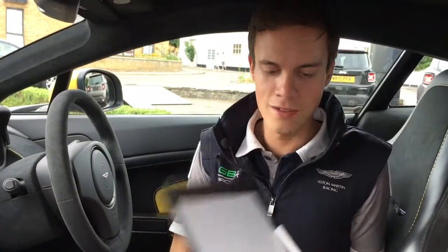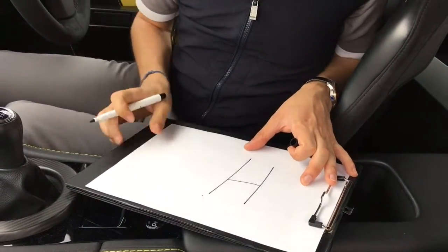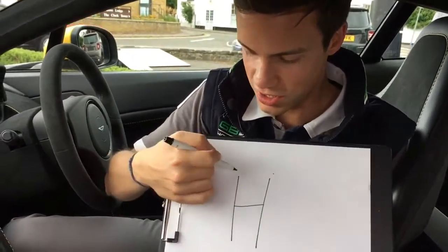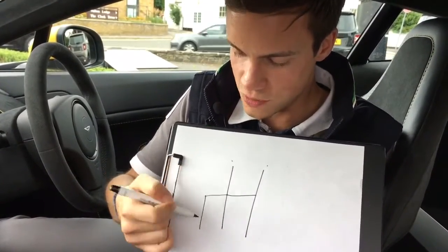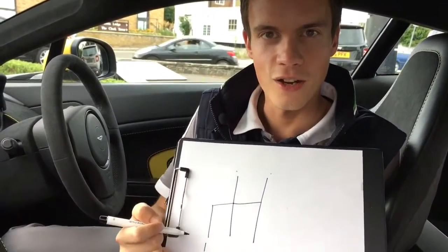2017 model year. Now, the key feature of this 7-speed gearbox is that it's a dogleg first, and we need to explain exactly what that is. And I've got my geek clipboard and pen, and I'm going to explain a few things. So, for racing cars, as 5-speed gearboxes became popular, you needed the gears that we use most on track to be most accessible. So, essentially, second would be up here, third, fourth, and fifth. And the first gear, the one that you didn't use much on the track, you would just use it for pulling away, would be out on a dog leg over to the side.